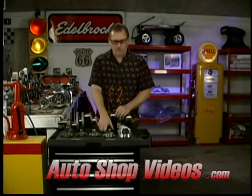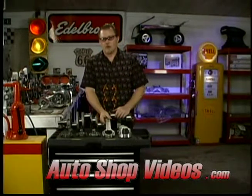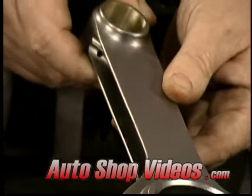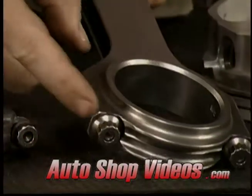If you're into hardcore stuff and the motor's going to make more than 500 horsepower, you can opt for H-beam rods like this. This is 4340 steel — a lot stronger than 5140, a different alloy. It also has cap screws that come all the way through. These are monsters.